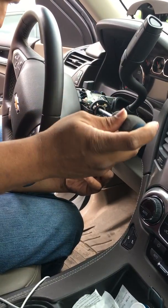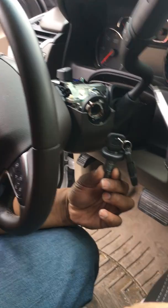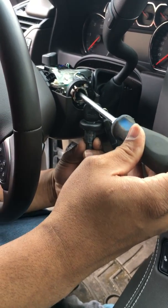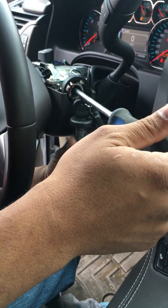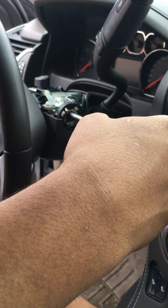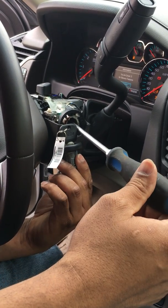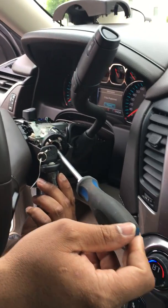By turning the car on, we're going to get a big enough screwdriver and rotate the ignition switch to the on position. We're going to do this until the security light goes out. Once the security light goes out, it's detected the master key and we're going to try and program the new one within 10 seconds. You have to put the replacement one up, and as you can see on the screen here, it says three keys are now programmed.